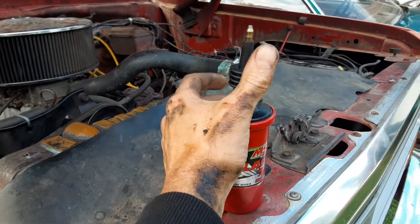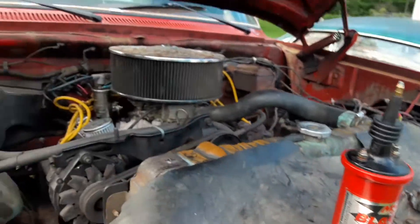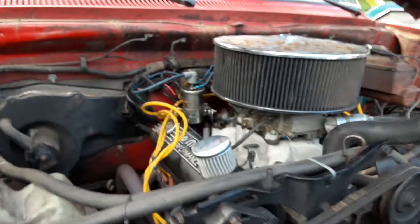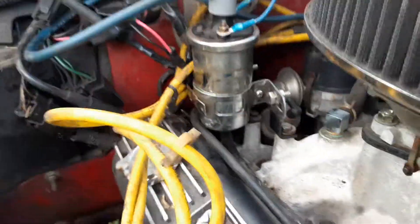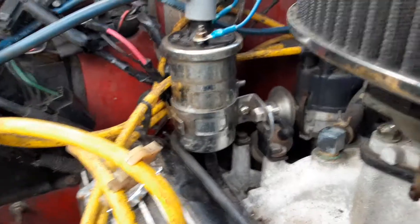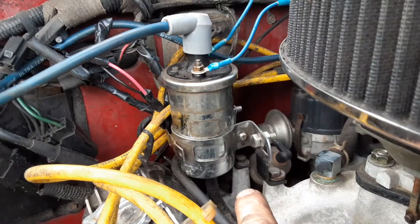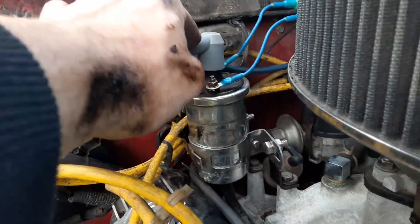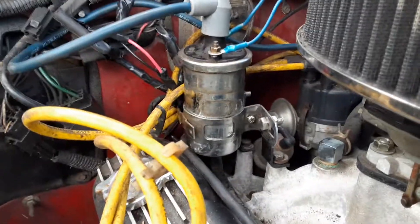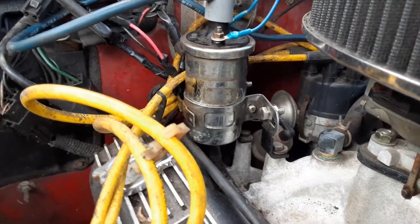In my opinion, I'm not 100% sure, but that's what I think. What I did was I got flat steel, bent it to 90 degrees and bent to another 90. From the bottom to center the front is 2 inches, from the bottom to center is 3 inches. Now my coil is mounted vertically. Since I did that, I have no problems — it's been running the best it ever did.